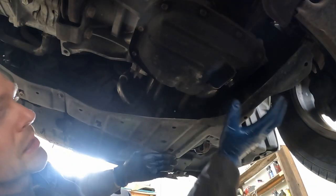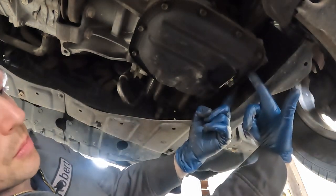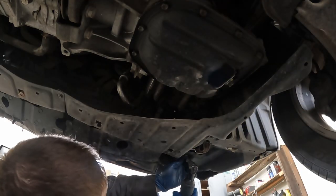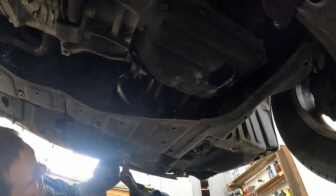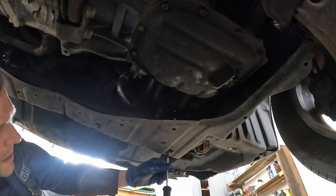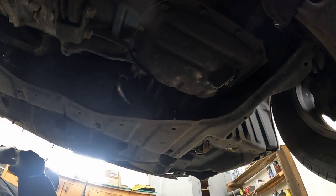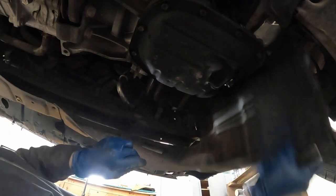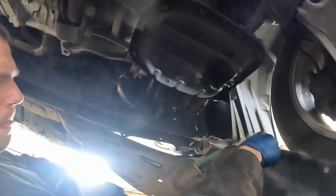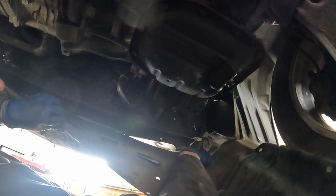Our first move is to take this plastic shield off. We have to get access to our AC compressor — the top bolts I think will be easier with this off. Over here we also have our timing cover bolts; we need to pull this off. Looks like 10 millimeter. There are a couple of push pins — the screw type with a Phillips head — and just a couple more clips here on the side of the wheel well. That should be out of the way enough; if you want you can remove it even more.